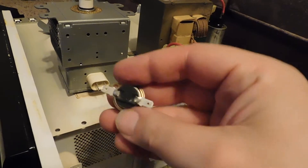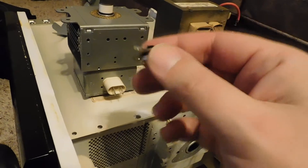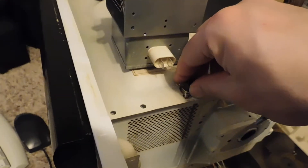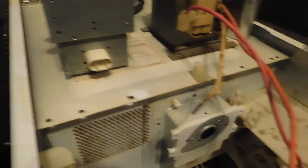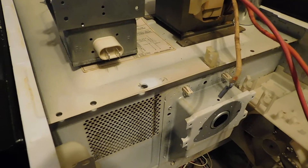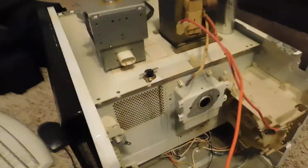The last component that's part of the microwave system is this little gadget here — the thermal cutout. It's basically a thermostat; you'll see similar things on coffee maker elements. It was sitting right up here and it shuts down power when it gets too hot. So if my microwave had caught on fire, the whole system would have just stopped — but at that point I probably would have been done for anyway, because fire is fire and everything in there is flammable plastic.